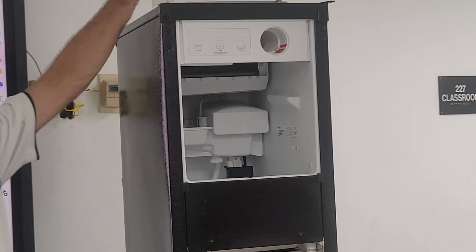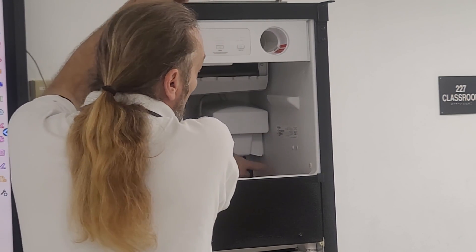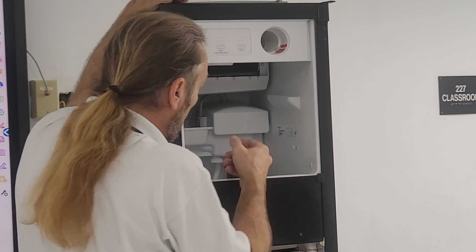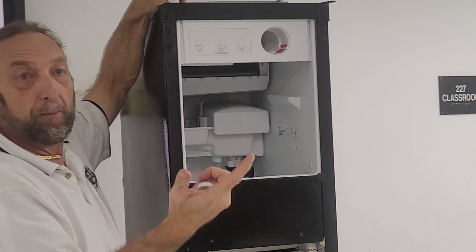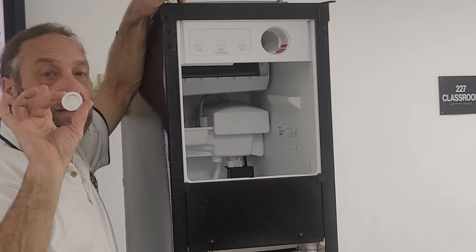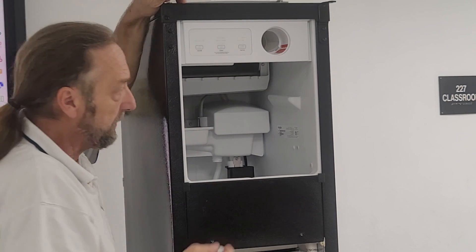This is the drain pump. Not all older machines have a separate drain pump — they used gravity-fed drains. To service it, you can pull this pump out from here. Down here is a small cap that allows you to manually drain the reservoir by removing it, and all the water flows out into the bin, which has a hole in the very back where the water drains out of the unit.